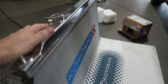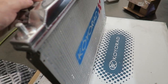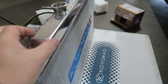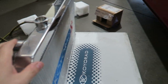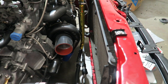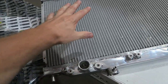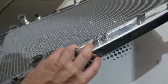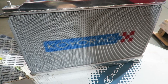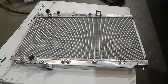This is the radiator I ordered — it's gonna be plenty enough cooling, and it's quite a bit thicker than the factory one. It's not as thick as the Mishimoto, but one of the things I like about it is it's a good brand and it's thinner than most aftermarket ones. We're trying to keep as much room as we can because the radiator sits here and we don't want it getting any closer to the turbo and the hot sources. So by being a little bit thinner it gives more room. We're gonna put a pull fan on this side and a pusher fan on the other side to get good flow across the whole radiator and keep the air conditioning working correctly.